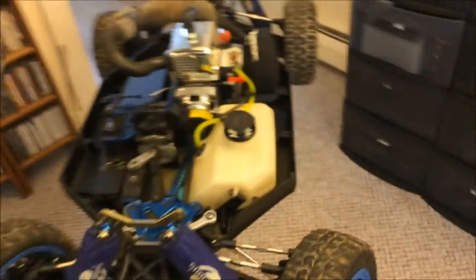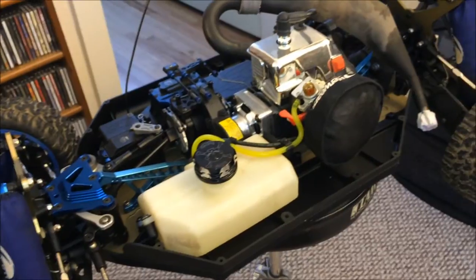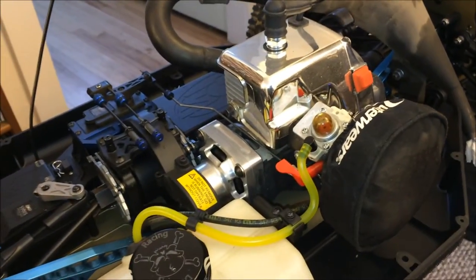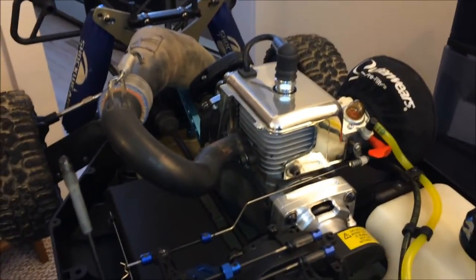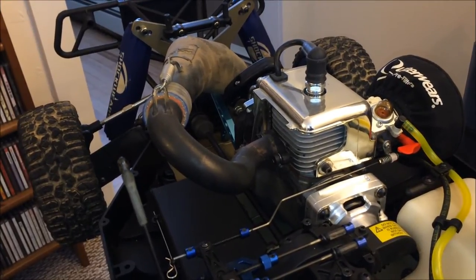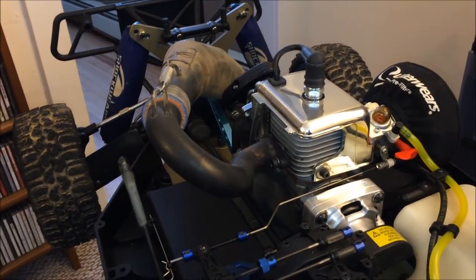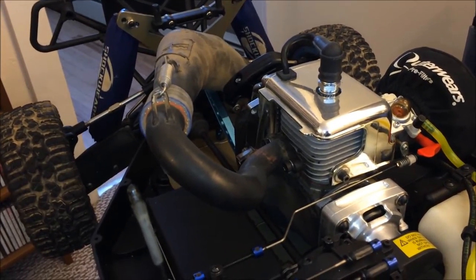Let me show you the underneath of a 5T real quick. The Outerwears is right in the roll cage. This is the stock engine that has been modified by me. It does have an ESP Big Bore kit — the stock engine is a 26cc engine. When you put a big bore kit on, it increases the size of the piston and in turn increases the size of the cylinder opening. It is the stock crankcase but with a bigger piston and a bigger cylinder hole — so it's now bumped up to 28.5cc. It also has a race-ported cylinder, meaning they port out material on the intake and exhaust for better airflow and higher performance.